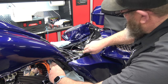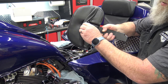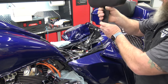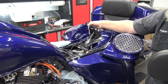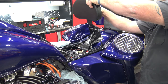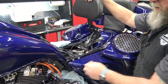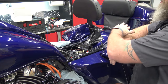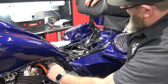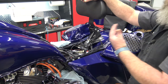Now that we have that, grab this and pull it, and you'll see that it's pulling this here. On the backrest itself, you'll see a pull knob that you can pull — it's spring loaded. You can lift this up and down through several notches. There's also a notch in the bottom that's going to catch here. You've got a spring-loaded lever on this, so you're going to open it up, slide it in, and lock it in. Now you can adjust this up and down wherever you want it. The lever itself will control the piston, which will lock into place wherever you want to keep it. All this lever down here does is release it — it doesn't actually move the backrest. So this just releases the piston, and you can push this back to where you want it. Let go of the lever and it stays right there. It's easier to do sitting on the bike because you can use your back to push back on it.